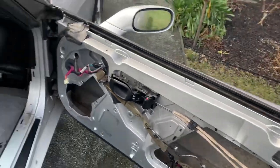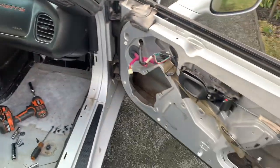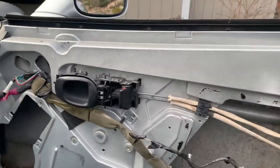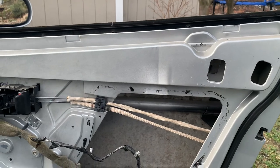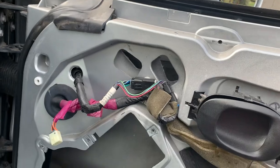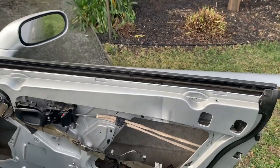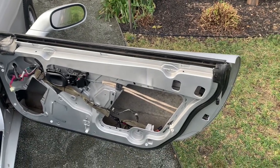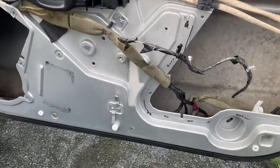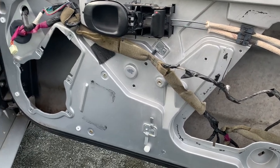When I add ballast, I'll put the weight back towards the passenger floor down low, which is really where the car needs it anyway - so for an optimum build, I would do something like that. Getting the regulator and glass out is also extremely easy - you're talking about a couple of minutes. In this porthole here, and again over here, there are little 13-millimeter head nuts that hold the glass in. You just take those out completely and then you can lift the glass out of the top. Then you pull the remainder of the 10-millimeter head nuts out to get the window regulator out itself. Super quick and fast.